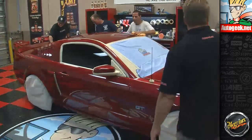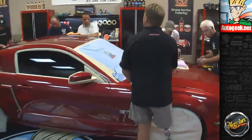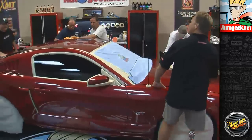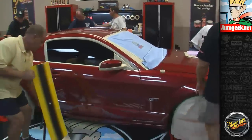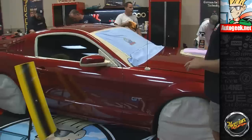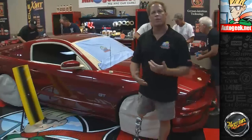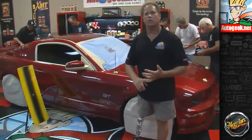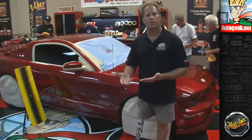Okay. And how we doing over here, guys? Did anybody feel this besides me? Brandon, you felt it with the baggie test, right? You could feel the little bumps on the paint. Okay, so that's just the sign that something's on there. And the first thing you want to do is get the contaminants off before you start machine polishing for a number of reasons. One is you don't want to loosen any of those contaminants and get them trapped between the pad and the paint where they could possibly micro-mar the surface.